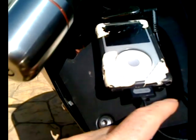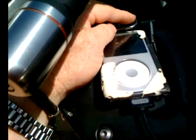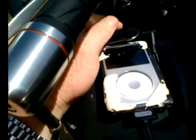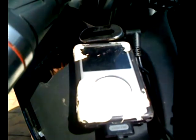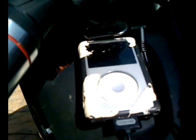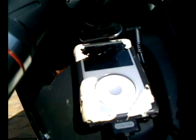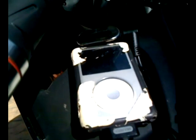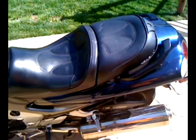The iPod case has a loop on the back and the velcro piece attaches it — pretty tight. Now, the problem with an iPod is that out of the iPod itself you're only getting about 2.9 volts to push to the amps. If you're pushing that kind of voltage to the amp, you have to use the gain on the amps to get any sound out of the speakers, so you're basically pushing the compression up into the speaker to make it sound louder.